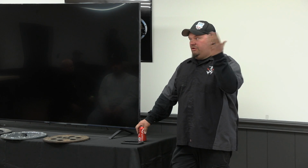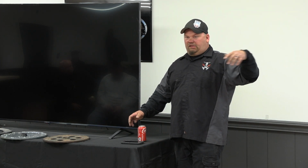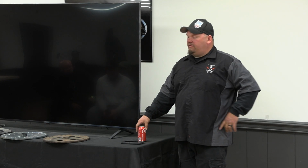And that's why I tell everybody, even with the EFI, this came out of a Tahoe that drove in my shop. No noises, no misfire. That's the one you use. Not the one that's been sitting under the bench for 3 years, because those injectors are full of crappy gas and sludge, and you fire it up and then you're switching stuff around.